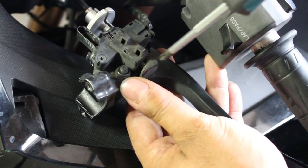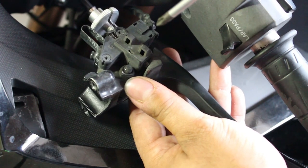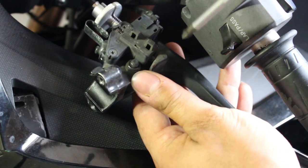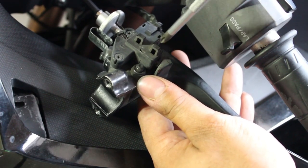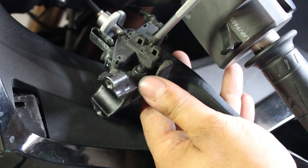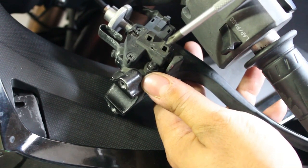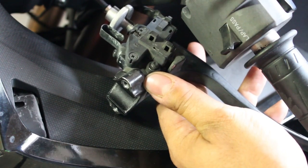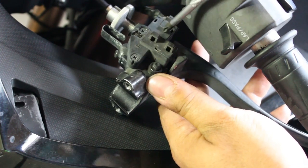The whole purpose of this switch is to detect when the clutch is being pulled in or not — it is basically a safety switch. For instance, if you are in first gear you should still be able to pull the clutch in and start the bike, as long as the clutch is pulled in even if you're in gear. That's the way Kawasaki's are set up. However, this one's malfunctioning, so whenever I am in first gear and I pull the clutch in it's not registering. This is especially important if you're in the middle of traffic, the bike stalls, and you need to immediately start it back up. It's no longer allowing that, so this is a safety hazard.